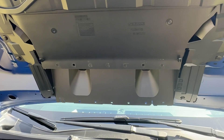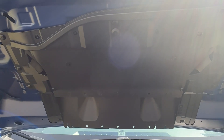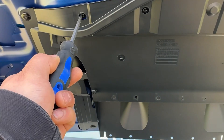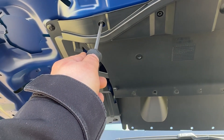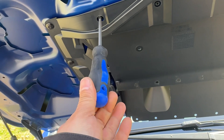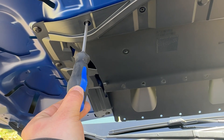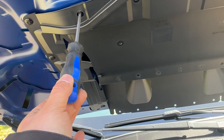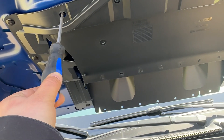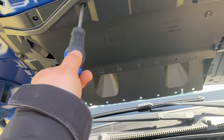The last thing about this hood scoop: you are tightening it down into plastic studs. The best way is to take a screwdriver, tighten it down with a full hand, and then when you start getting it tight, move back and use three fingers. Keep turning until you can't turn anymore — that's tight enough. You don't need to torque it down; by using three fingers you're not applying full pressure, just enough to create the resistance needed to hold the piece securely.